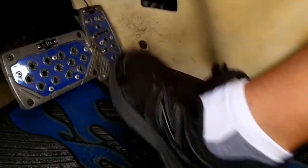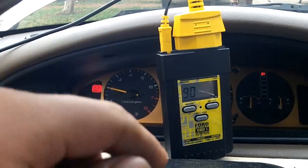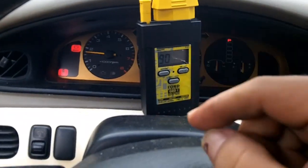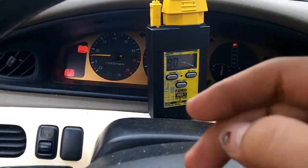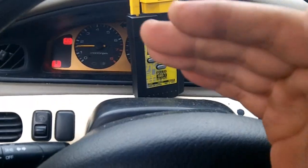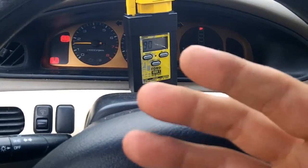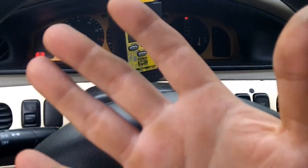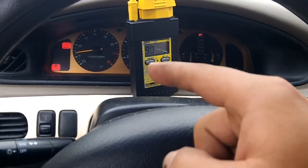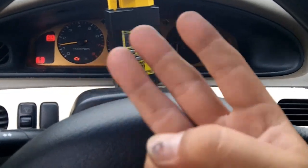If you want to do the second level test, you just go down and do the same thing — just a little bit of throttle. It raises up and now we're doing level two. If you did not pass on level one, the ECU will basically say, how bad is this cylinder? So level two cuts even less fuel — for example, the injectors are cutting by 50% now instead of 65%. If it still shows a bad cylinder on level two, that's basically going to be a clogged fuel injector, bad wire, or a bad cylinder.